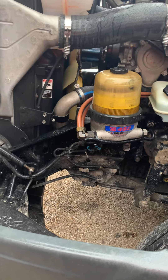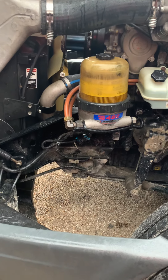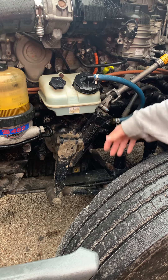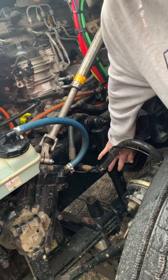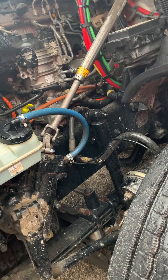Start with your front and rear leaf spring mounts — they're properly mounted and secured, nothing been broken or cracked. I got my leaf springs, properly mounted and secured, nothing been broken or cracked, and there's none missing or shifted. I got my U-bolts and saddle, properly mounted and secured, nothing been broken or cracked. And then I got my shock absorber and shock mounts — they're properly mounted and secured, nothing been broken or cracked, and there's no leaks.